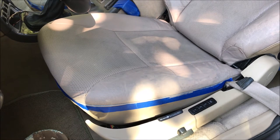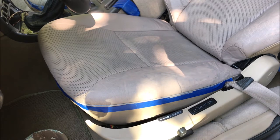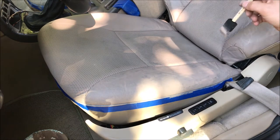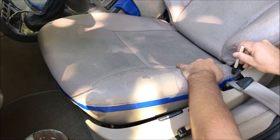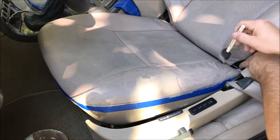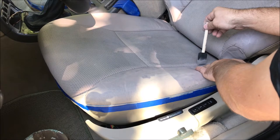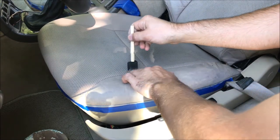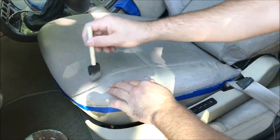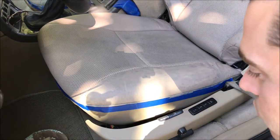At this point I've done the passenger seat and driver's seat. If I was to do this over, I would do the bottom cushion first and then the backrests. I have a small brush that lets me get really far back in and put a light coat on everything I don't have access to — it's also really nice to get in all the seams. Just be careful not to flood this perforated leather, but do try to get dye down in to get everything coated. Let's do another coat on this bolster and see what happens.